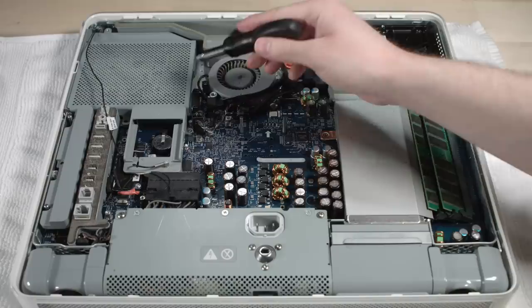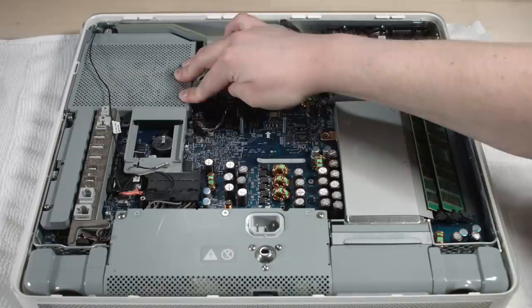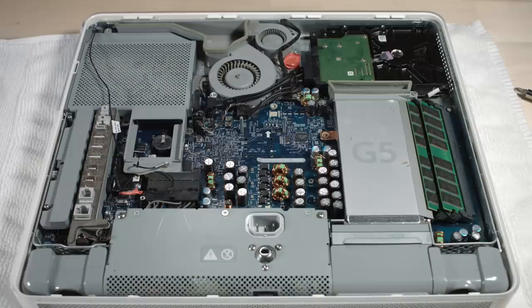Okay, I actually just discovered something. I was pressing on the optical drive, specifically on the connector here to the board, and it was not down all the way. It's down now because I pressed it earlier, but it moved by probably at least a millimeter. It did not feel like it was plugged in all the way. So maybe that fixed the optical drive issue. This tag is about to rip off. Well, if that's all that was, that'll be an easy fix too.